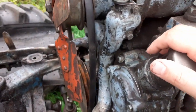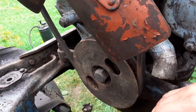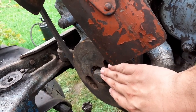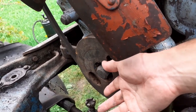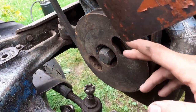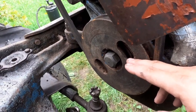I also had to replace the crankshaft bolt with the correct nut — I'll list the part numbers in the video description. The old bolt was sheared off because people use the wrong tool. Even if it's a worn wrench, it just skips over the hex and then the nut is gone. I think it's a 32 socket you have to use on these.